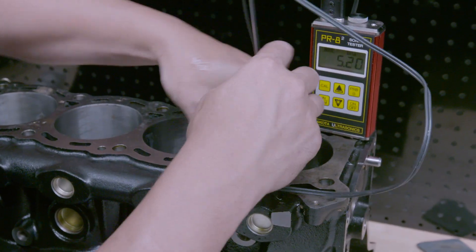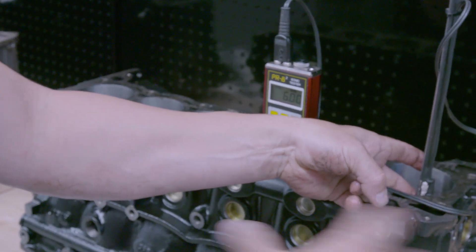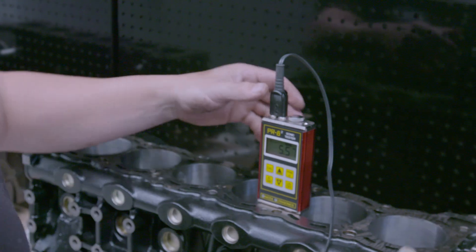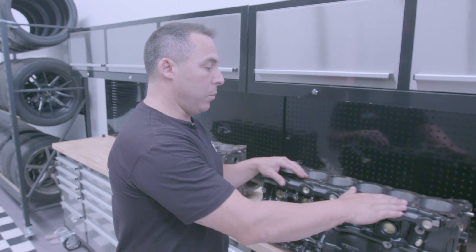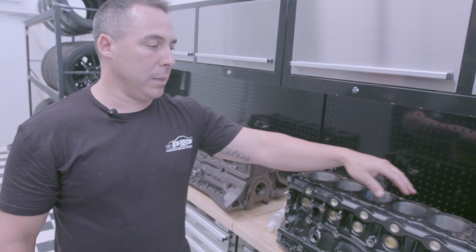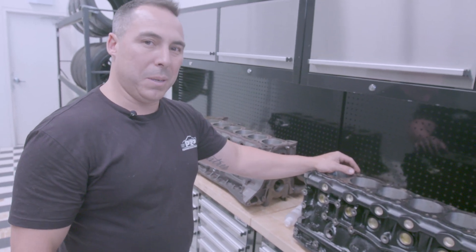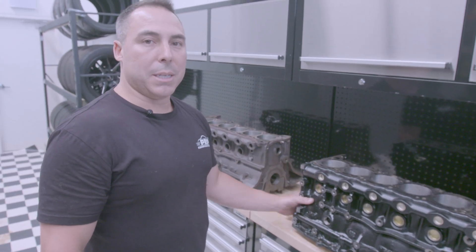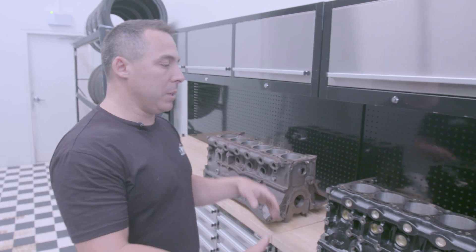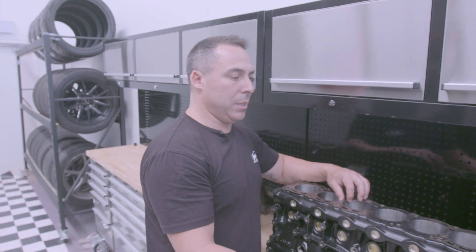The other side measures 4.8mm, and the back wall on the last cylinder is consistently 6mm — nothing to worry about there, about 5.5mm. So all in all we've got three or four thin cylinders under 3.5mm: 3.2, 3.1, 3.0, and 2.9mm on the back of cylinder five. I'm shocked and a little bit disappointed — happy for the viewers but mixed emotions. I think Nissan's let me down again. Was it a mil thicker on average in these bores? No — maybe 0.2 to 0.5mm on average, and then in the thinner sections it's actually on par or worse.